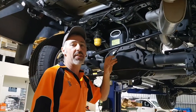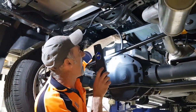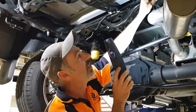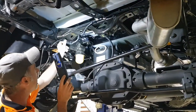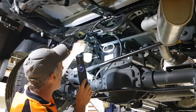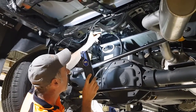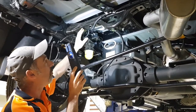Here we are with the bracketry underneath the 1500. The front short angle iron is right up snug against that top hat section, and the other one is tucked in here. We had to deal with this wiring loom that runs across. The ABS connection electrical connectors are there — pop them off, disconnect that wire. It's normally here and you've got to change it, run it back. That Y section ends up on the front side of this rail. It's a bit tricky to do, but then we can cable tie that back on there.